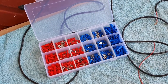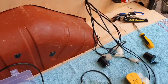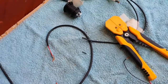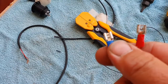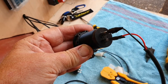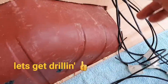I've got my connector bits here that I've used in Betty One — crimpers, splicers. I don't really like using crimpers; I tend to just use a pair of pliers and crimp them over and clamp them. I'll just wrap a bit of insulation tape around to protect it. Red goes to the positive, black to the negative. That's two sockets ready to be fitted, with enough wire cut to reach the fuse box.